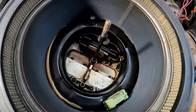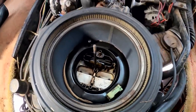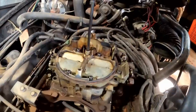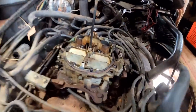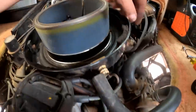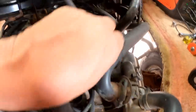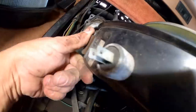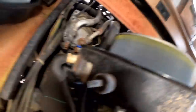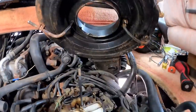That is a pretty sizable air cleaner and filter, and there's that big four-barrel Quadrajet carburetor. By the way, I did find an issue with that — somebody did some handy work thinking they knew better than the engineers. Now, look how many hoses were hooked to this air cleaner: there's one, a big fat one; two; a small vacuum line — three; another one — four; five. What a mess.